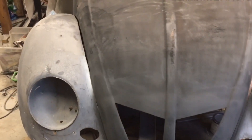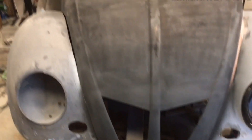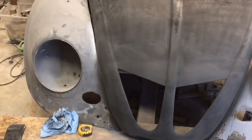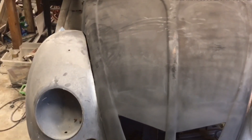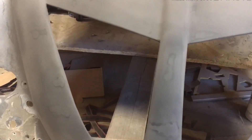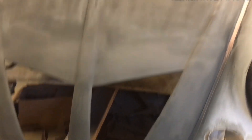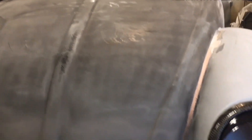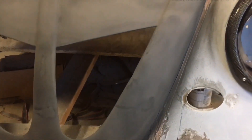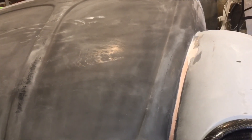Now I'm gonna start working on the passenger side fender. I'm gonna get the hood mounted back up to where it needs to go. I need to trim the fender a little bit to get it to where it needs to be, but the front is looking pretty good. I still have to fine sand a couple areas very lightly, smooth it out, and then the actual hood itself is done. Still haven't gone around to doing where the fender meets — I'll fine sand that out, get that all nice and good.